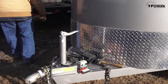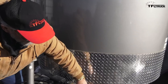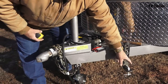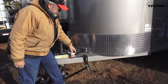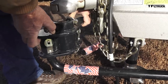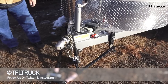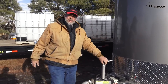This is an L bracket. When you put this on, it's adjustable to height. You'll measure your spring arms to make sure that when you turn corners, it doesn't pull out or push too far in. Spring arm brackets are in place. I've got the spring arms on here and I'm showing you how that works — the L bracket goes in there, and that's where it slides through. It goes back and forth, slides in and out. You can see it grabbing; that's what it'll do, grab on that bar as it goes through. And we'll be ready to go — all safe with our weight distributing hitch. See you next time.